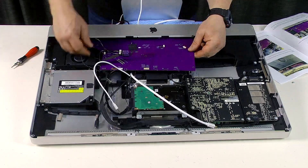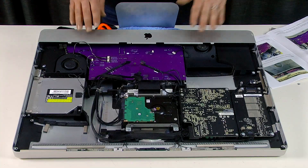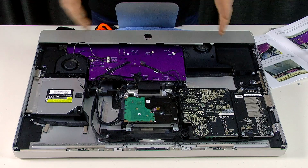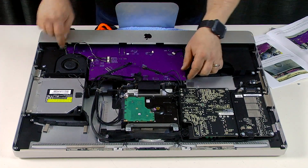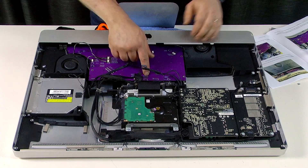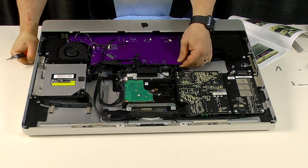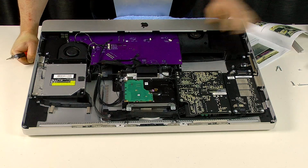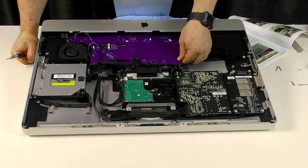During this process I'm plugging in the left and right speaker connectors, the CPU fan, the power button and power supply. My recommendation would be to stand the board upright so you can feed it into the little slots at the bottom. I also got a little bit caught out because the board doesn't sit flush — it sits a little proud. The holes still line up with the screws so we can screw it in. I've just used two screws and it's in pretty solid — it's held in place at the bottom via the little notch for the board to sit in and that's not going anywhere.